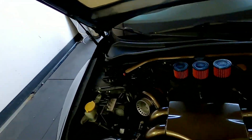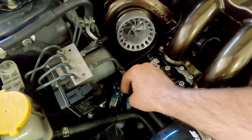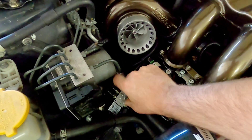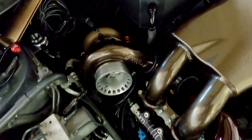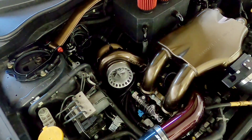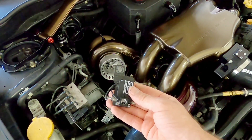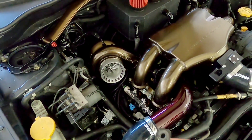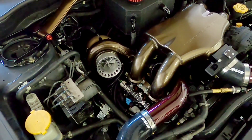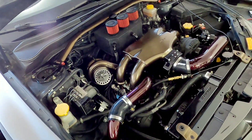So how did we get 8 pounds more boost out of it? What I did — and this isn't a final install, I just zip tied it in here to get it going — I now have a 4-port electronic boost control solenoid. When you run a 4-port it allows you to have full bleed control to the top and bottom of the wastegate. There's the wastegate down there — it's just a Tial MVR, a single Tial MVR, and it's actually recirculated into the exhaust, which is why this car is so quiet at wide open throttle. Before we had the GrimmSpeed 3-port, and nothing against that product — it's great — but when you have one of these you can only really effectively run about 2 to 2.5 times your wastegate default pressure. We were actually well over that, closer to 3 times, using a top and bottom bleed style, but it still just isn't enough. With a 4-port you can run 5, 6, 7 times your wastegate spring pressure, basically until just the exhaust housing back pressures out.